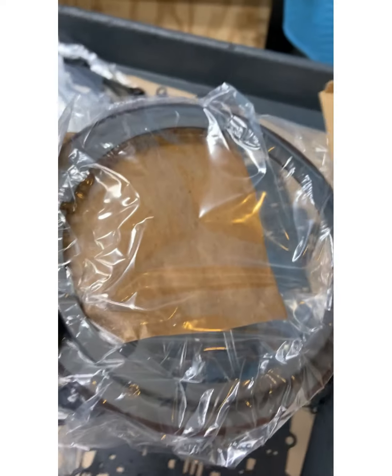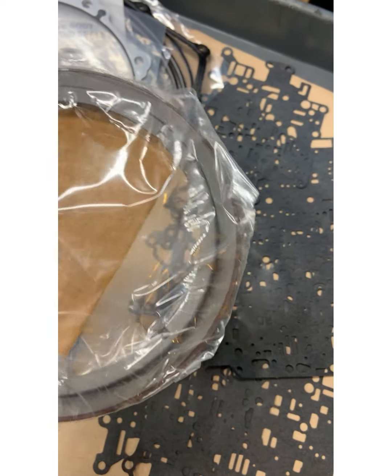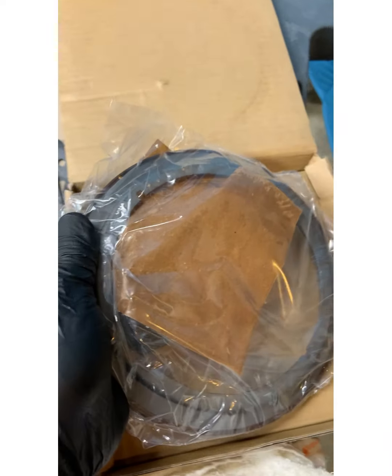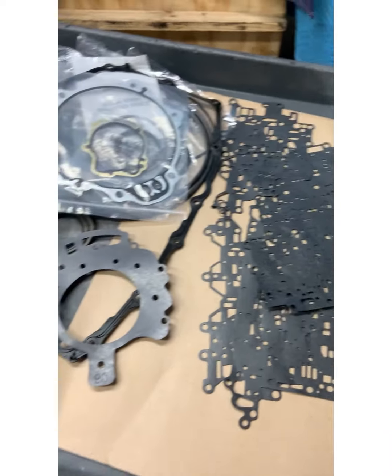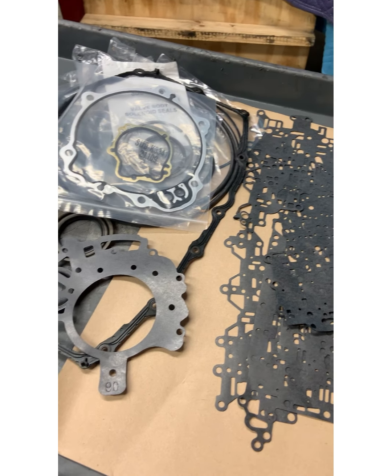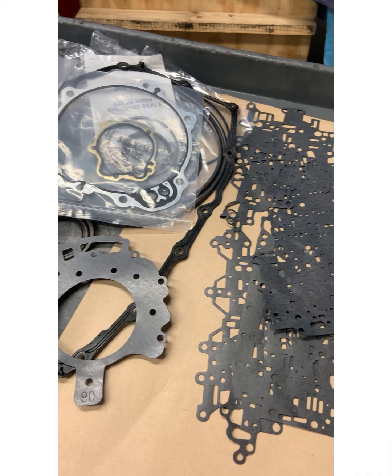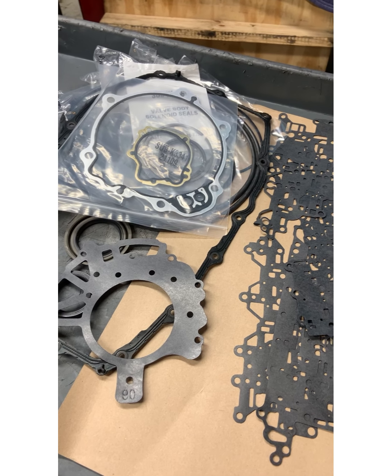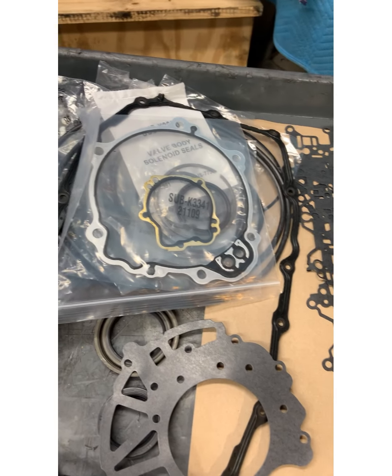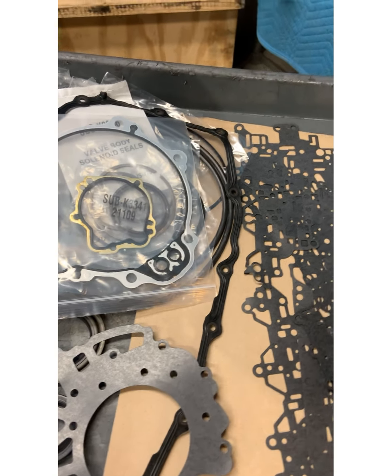Let's take a look at our molded piston. Here we see the molded piston — there's only one in the 8L90 — and this is for one of the brakes. It looks like they have an updated material here, a little different from what I've seen originally, but this is all part of what we do in an overhaul. The first step is replacing all the paper and rubber. In some transmissions, especially when the fluid gets really hot over a long period of time, rubber lip-type, square-type, and o-ring-type seals get hard and brittle and start leaking — and of course the front and rear seal will leak. So this is all going to be part of the overhaul.